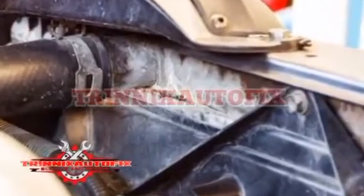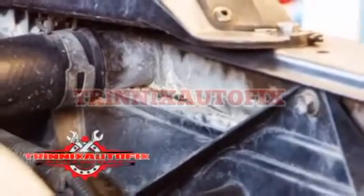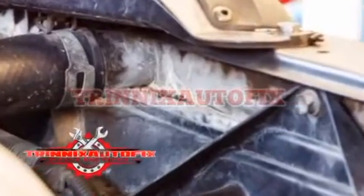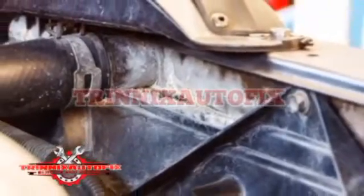2. Not enough clamp torque. The hoses are held on by clamps. Each of these clamps must be tightened to a specific torque to keep the hose in place. If you haven't applied enough torque, the clamp can become loose, leading to coolant leaking out. You will see moisture coming from the hose where it meets the clamp.